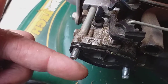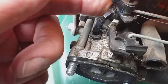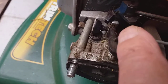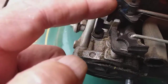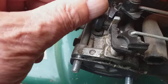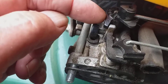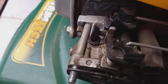I took this off, as I mentioned, just to show you better. Take this away, screw this out so that it is flush there. That screw thread is flush on this side, so that this butterfly top part can move freely, like that. There must be no drag. It must be free. I am very sure that part catches there and it cannot come back to idle.